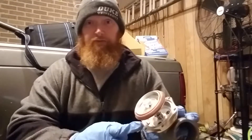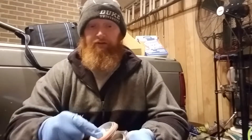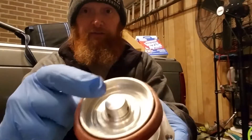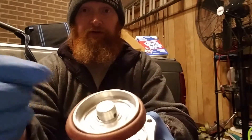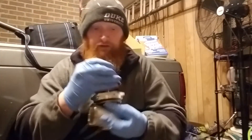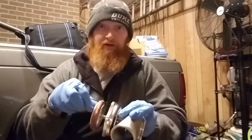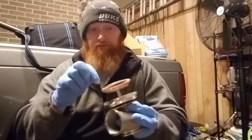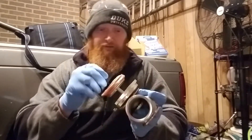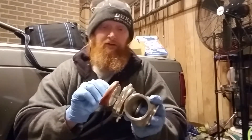Thinking about it — if I'm putting pressure in on the bottom port below this diaphragm and this thing is just hand tight, it makes sense that it's gonna leak up through there and come out right here. The diaphragm is what seals this cap — which you put the grub screws into to hold the valve — it seals that from the spring seat. There's no actual o-ring in there; there's a little o-ring molded into the silicone diaphragm itself. So you don't have to get the grub screws insanely tight, but they just have to hold on to the valve.